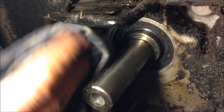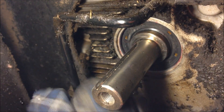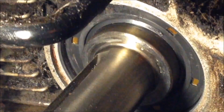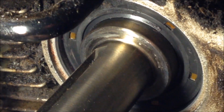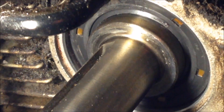The seal is in — got it in about an eighth of an inch. Wipe away any excess sealer. I installed the seal a little bit more than where it was originally, but not all the way back — if you go all the way back you're going to cover the hole that connects this area to the crankcase.